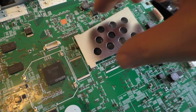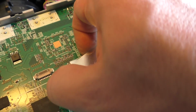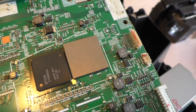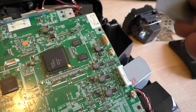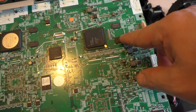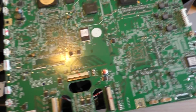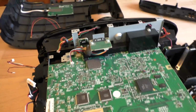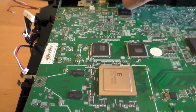An interesting detail, it seems these shields here are not soldered to the board. They have some sort of clip connectors and they can just be removed. So there's another heat spreader probably, or maybe it's only an RFI shield. We have RAM, we have a big Epson chip, so this is one unit. It seems to me that everything belongs together. I'm sorry, sometimes I'm searching for words.